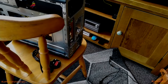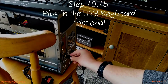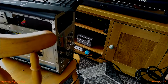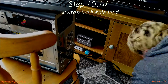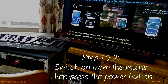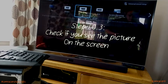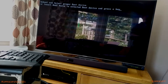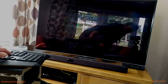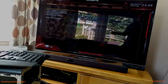For the front panel connectors — power, LEDs, HDD — the triangle marking is very small. The minus goes at the top. The power LED connectors are separate. Now for the final test: plug in the keyboard and mouse, plug in the HDMI and kettle lead, make sure the PSU switch is the right way, and switch it on. It has posted — you're in the BIOS setup, which means it's up and running.